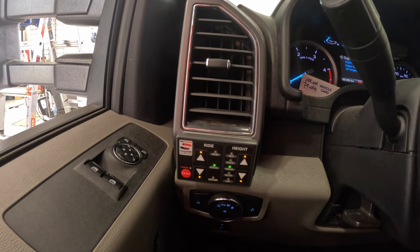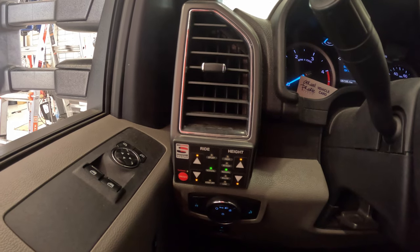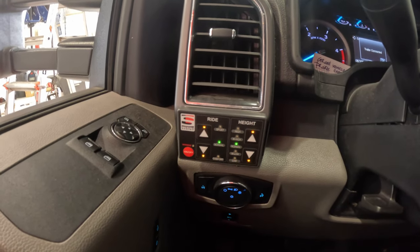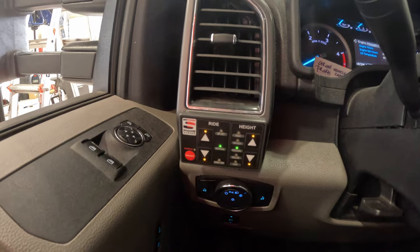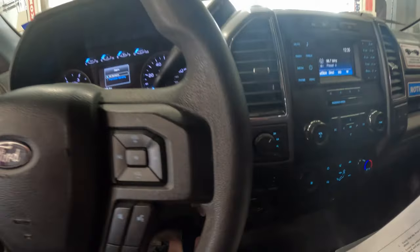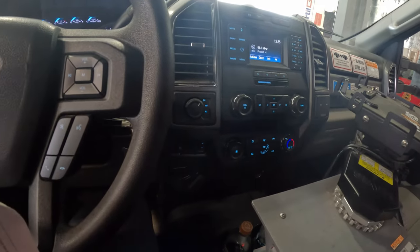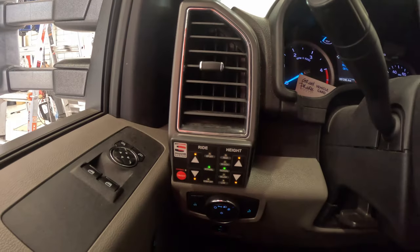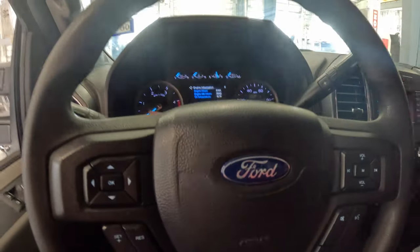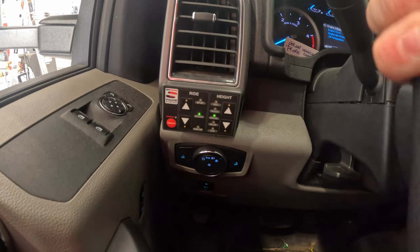It's going to get back down to the normal position — it is just one cycle through. It does take a little while; it's probably a good two minutes. After that's done and it comes back to the normal ride height, per the instructions they want you to cycle the key off, then wait for three minutes. That's basically the recalibration process. You can double check it — steering wheel in the straight ahead position, turn it 20 degrees to the left, make sure the yellow lights go out — they do.